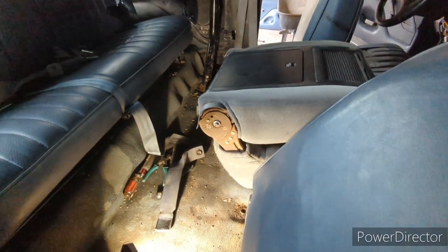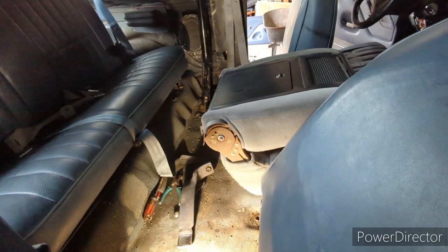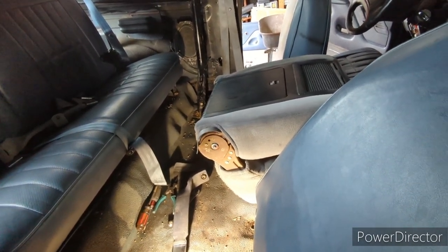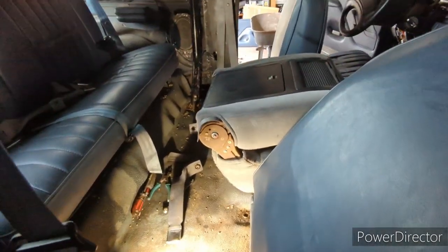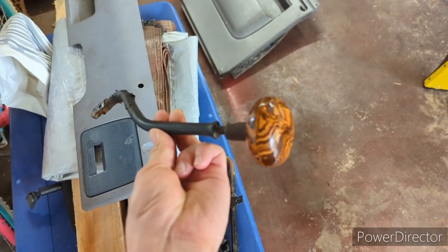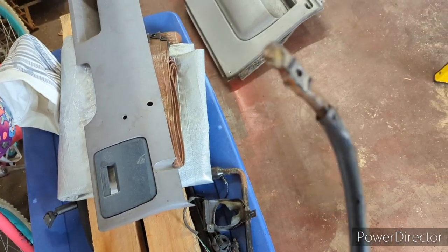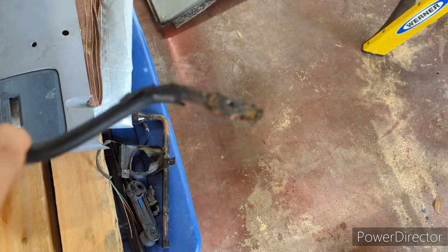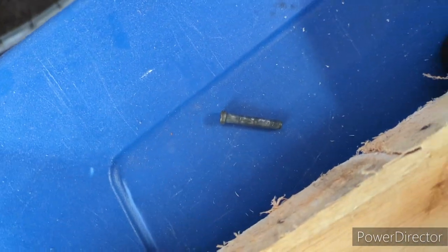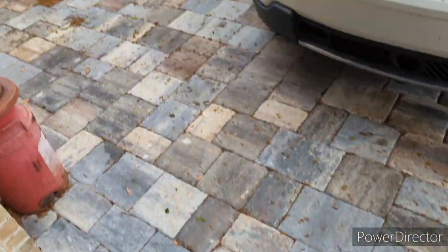The only drag is these side covers are missing, but I think I could probably touch that up with paint — just with a brush though, I don't want to spray anything with too much to tape off. We're going to get this thing bolted in and clean it up, vacuum it out, see how it looks. Changed out the shift rod — it's the old one with a doorknob I shoved on there. Really easy to do. There's a cotter pin that goes right through this little hole and then it just pulls right out. You stick that in the notch in the column and put the cotter pin back in. Super simple.